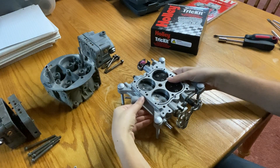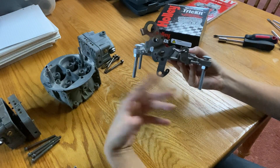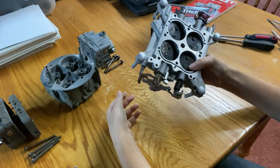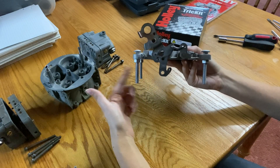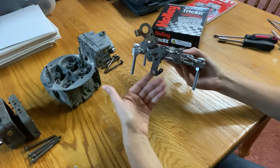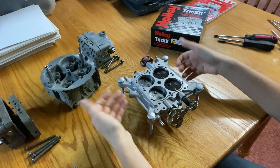This is part number 37-485, and this is going to have everything that I need to put this thing back together. Before I even do that, the very first thing that I like to do when I'm rebuilding a carburetor is make a little stand for the throttle plate. I just use 5/16th bolts and nuts, and that's just to keep the weight off of the linkages, but you can use carb spacers or whatever you have available.